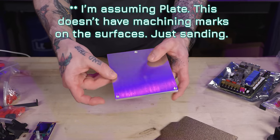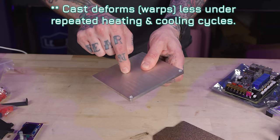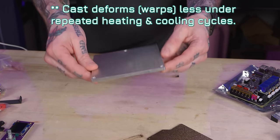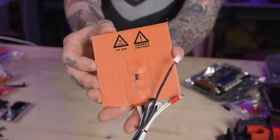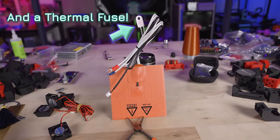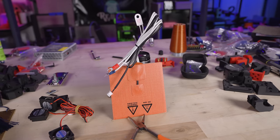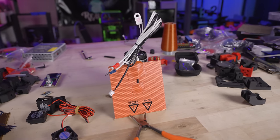The bed is a 6mm piece of plate aluminum. This is not cast aluminum as per the Voron spec, but it's definitely an upgrade over the last kit, which had a much wimpier bed — and that was a big deal because I made a big stink about it in the last video. This has a properly spec'd silicone 60-watt 24-volt bed heater included in the kit. The last one had a way oversized PCB bed heater. This is what I want to see from them and is an excellent step in the right direction.